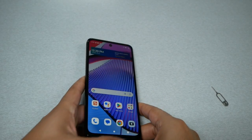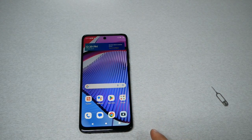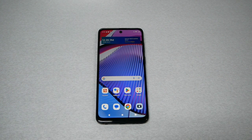If the phone doesn't read the SIM card, restart the phone and make sure you're inserting an active SIM card. For the memory card, I would highly recommend turning the phone off before removing the SIM tray if you already have a memory card installed.